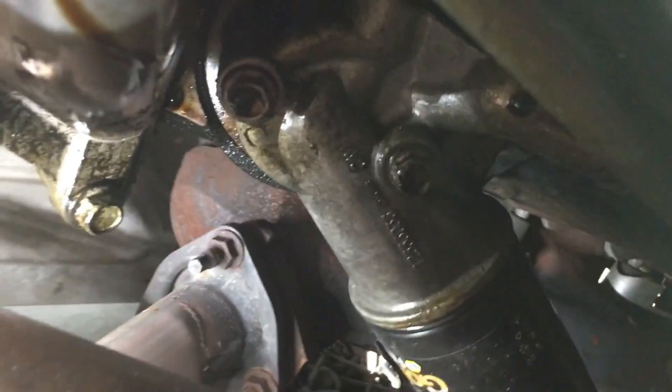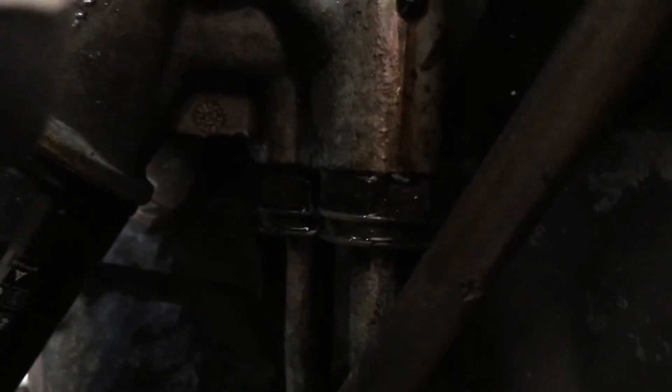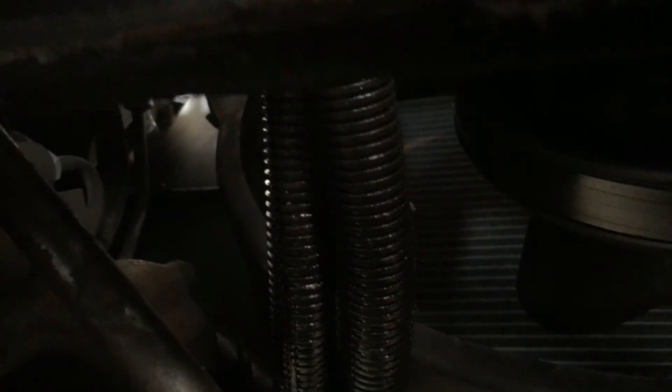You've got the adapter, and there are a couple of hose fittings right there. I've tried to take those apart without destroying them before and didn't have any luck. These things are going to have about 30 seconds to come apart, or I'll cut them and break them. You can see up here — these are the hoses that go up to the radiator. The hose itself is leaking up near the top connection, not at the radiator. So with all these problems, I've decided to eliminate all of this.